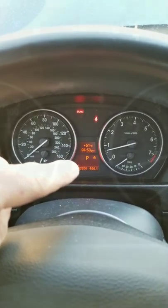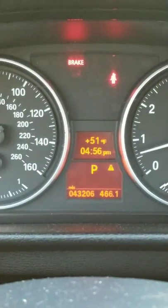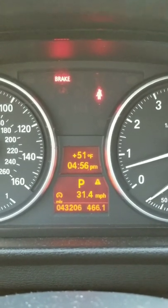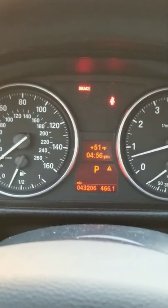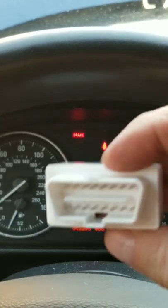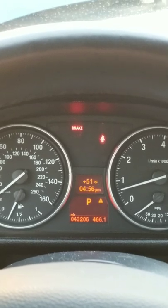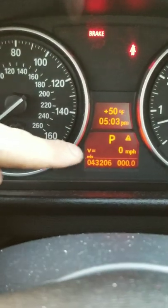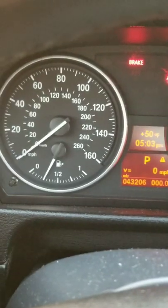The first thing I'm going to do is code this to a digital speedometer right here. Going through the menus, you can see: that's your gear shift indicator, that's how many miles are left in the tank, that's your average miles per hour, that's your average miles per gallon — and those are the only menu options available right now. So I'm going to use the Carly adapter, plug it into the OBD port on the side of the vehicle, make the coding change — and there you have it. Velocity equals miles per hour — I now have a digital display readout for my miles per hour speedometer.